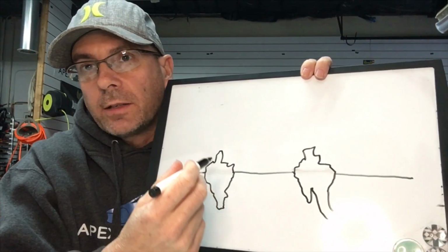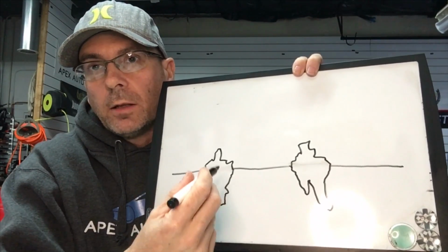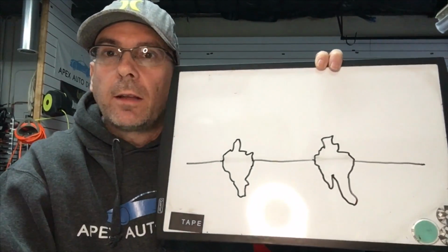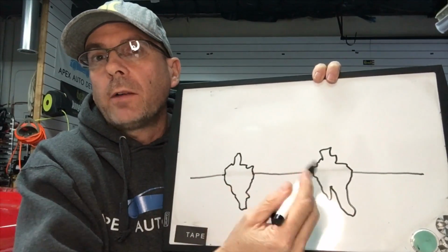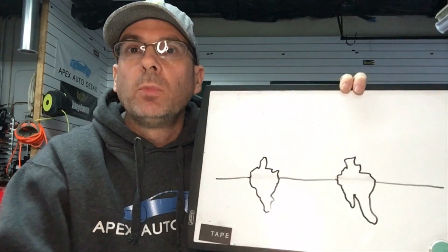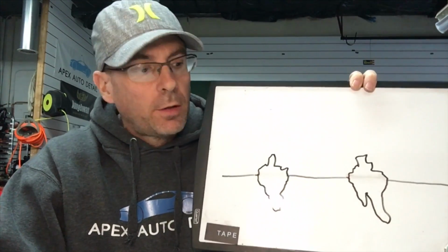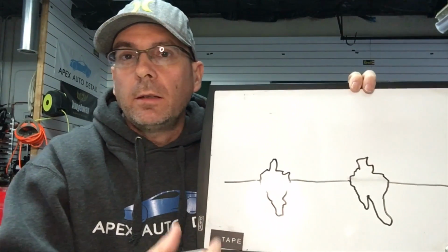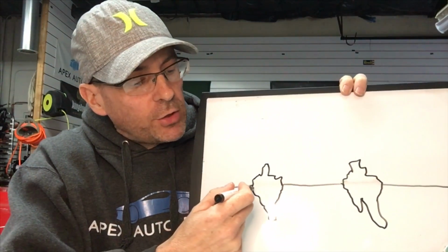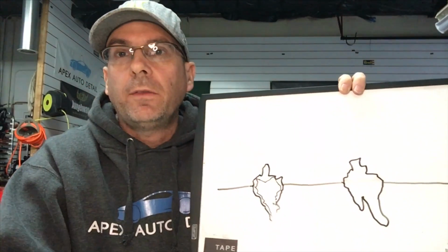When it comes to ferrous metal, guys, coming from brake systems, it's flying onto your clear coat hot. It tries to work its way into the clear. If you're looking at the clear coat from the side of the panel, these jagged edges here representing the ferrous metal. When you spray the iron removers on, what happens? How does it remove ferrous metals? It doesn't really remove them. It causes an exothermic chemical reaction, hence the color change. And it really just changes not so much the composition, but the structure and the shape of the ferrous metal.